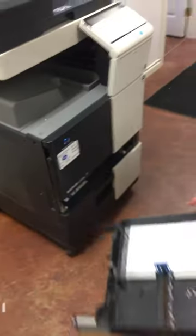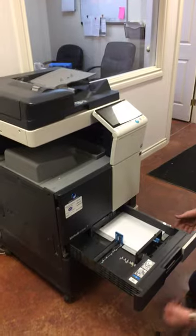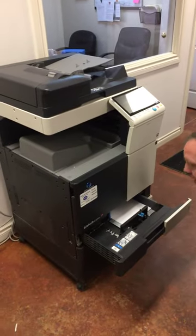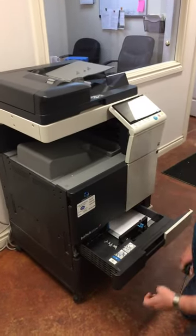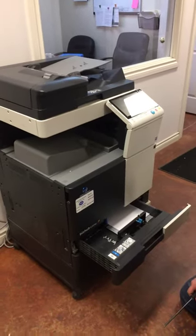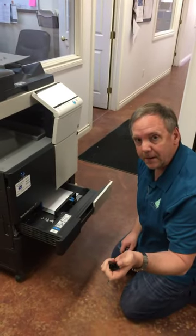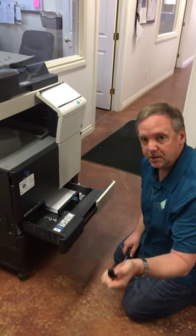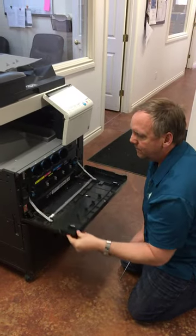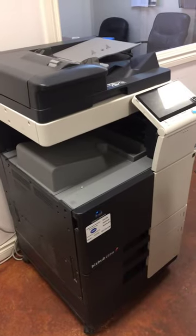When you're finished, take your paper tray, line it up, lift up slightly, and just wiggle it back and forth to put it back in. You can either put the screw back in, or you can remove it permanently — if you remove it permanently, you can get access back into your paper tray anytime, and it does not stop the machine from working. Close your tray, turn your photocopier back on, and you're finished. Thank you.